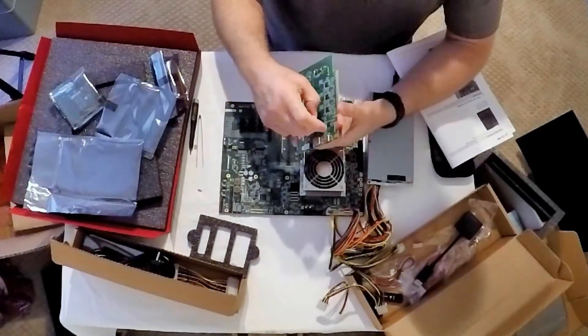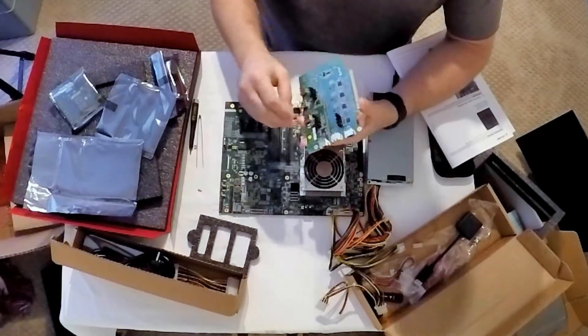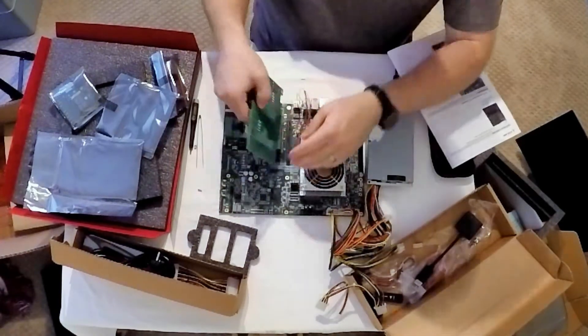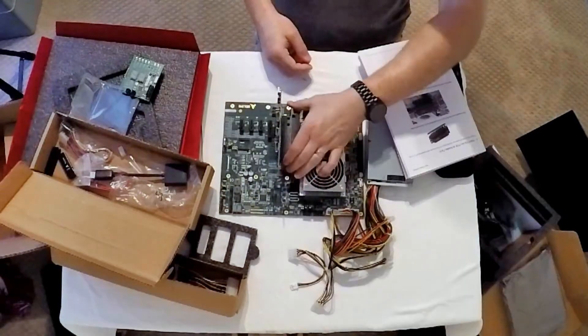Video output is provided via the T6 DDI video adapter card. In my case this needed to be set for HDMI output via jumpers. It can also be set to use DisplayPort as needed, and can accommodate up to three monitors.